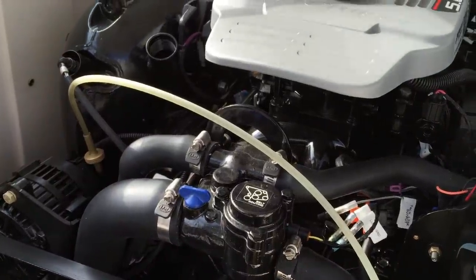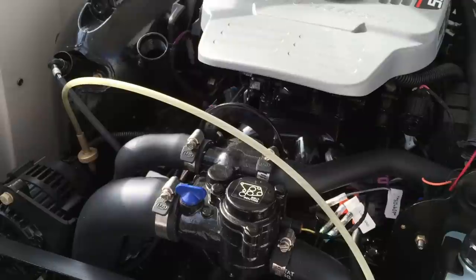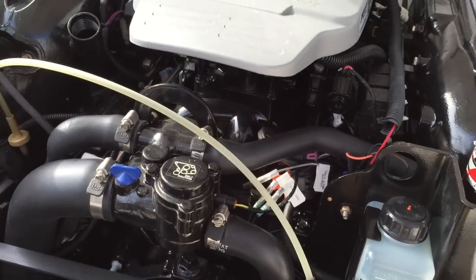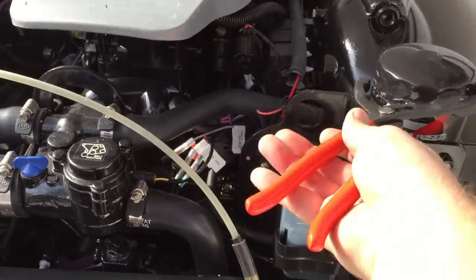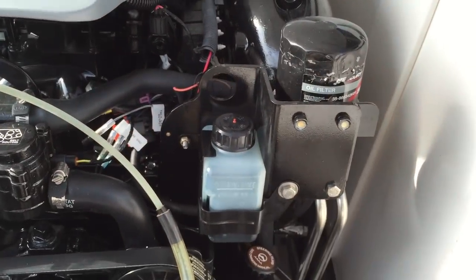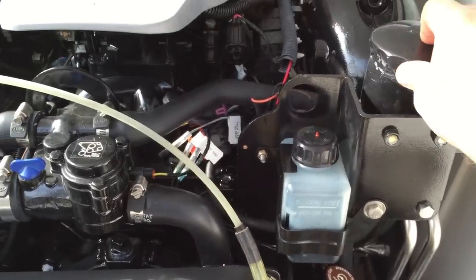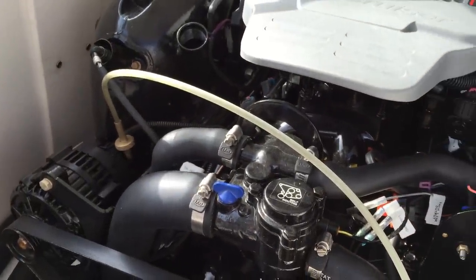Alright, we have our drip tube in down to the bottom. We're going to vent the oil filter — get our pliers here, grab a hold of it, and get it going. They can be a little sticky, a little hard to get loose. We're going to leave it sit on there for now until we get all the oil out. It is nice and loose as you can tell, to drain out. Now we'll begin to pump the oil out.